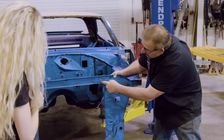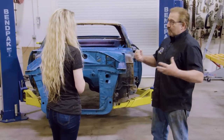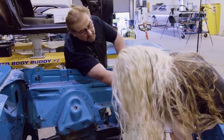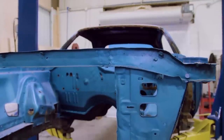When validating a car to make sure it's real and numbers matching, in this case we've got a 69 B-body — a Plymouth GTX. There are two hidden body numbers on this car. One is underneath where the weather strip goes on the trunk lip — it'll be the last eight characters of the VIN. That same number appears on the upper tie bar. These are both weld-in panels and relatively hidden. In the case of our GTX, while the core support had been worked on — it looked like somebody cut it, rolled it out of the way to get the engine out and then welded it back — at least the original body numbers were there.